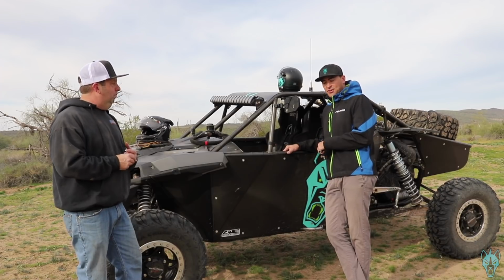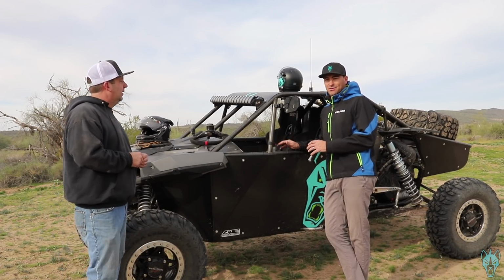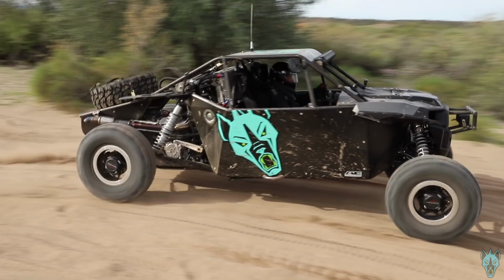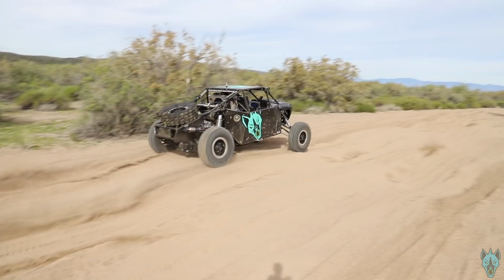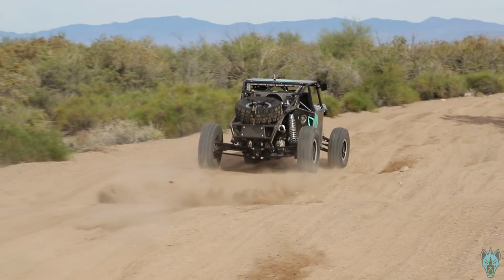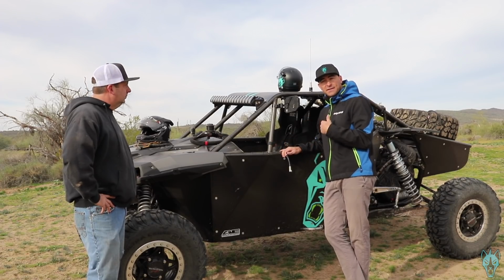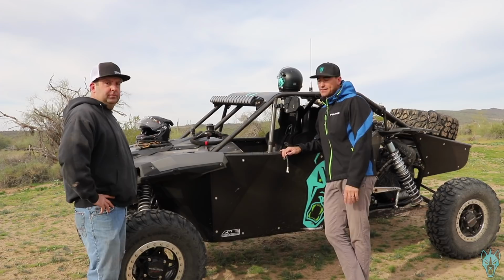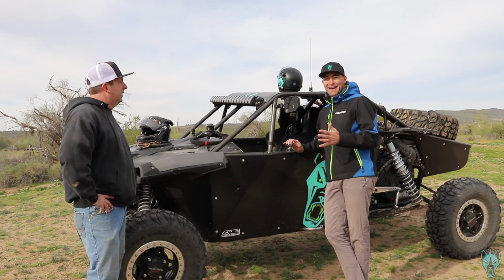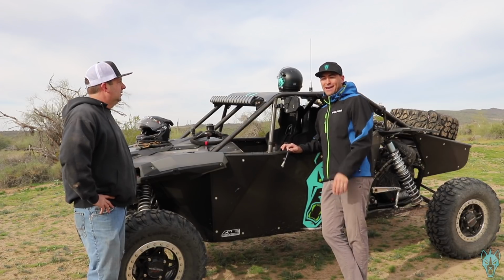Yeah, it's funny. Started off in this car, then jumped in the stock, and this car feels like you are going slower. Everything just feels safer. The track, predictable. One thing I was interested in, we don't have a front sway bar on it like a stock turbo does, and the much stiffer rear. Even though the ride height's comparable, we're like 16 in the front, 15 and a half in the rear, pretty close to what that car is set up at. This feels like it's in slow motion more, like everything's easier and safer, and you're not pushing it near as hard as when you get back in the stock car.